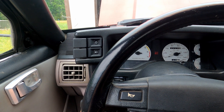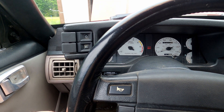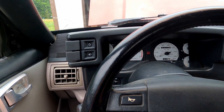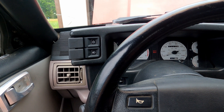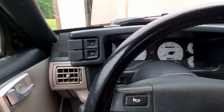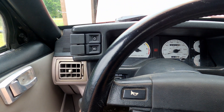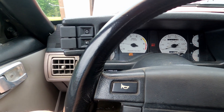What it's doing right now is testing the EGR. It's going to idle down. There, it flashed the check engine light. It's running codes — I know what these codes are, I've already done this. It's all because the smog pump has been deleted.